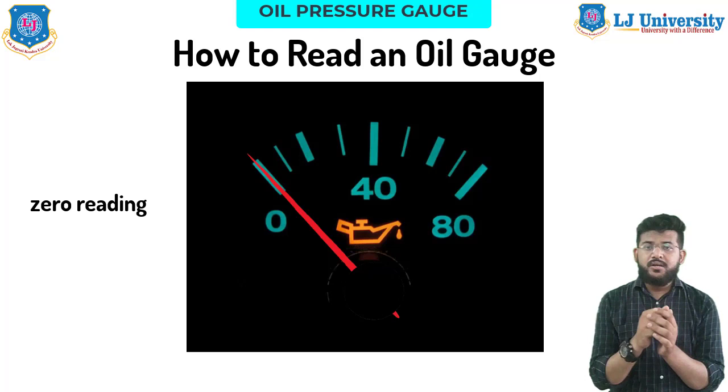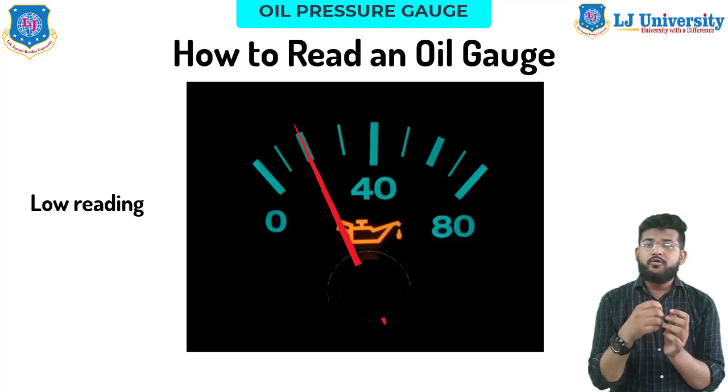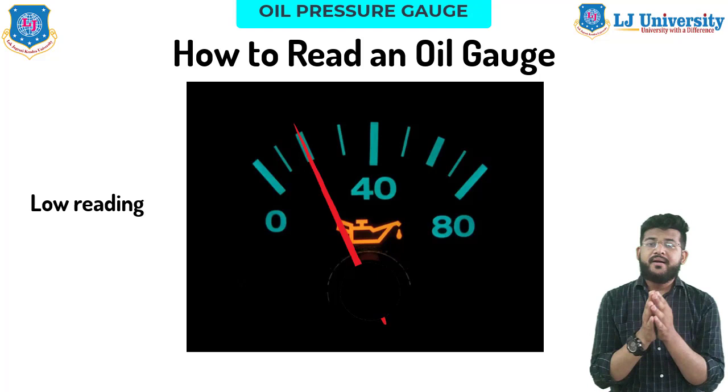Next is a low reading. If your oil pressure gauge consistently reads a lower number while the vehicle is idling — typically below 20, or the lower quarter — get it checked soon. It could indicate an issue with the gauge such as a leakage in a mechanical gauge, but it most likely means an engine component has worn down, creating a drop in oil pressure. By fixing or replacing that part quickly, you can avoid major and expensive engine damage.